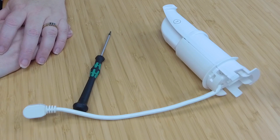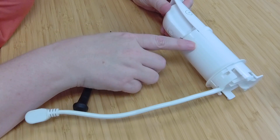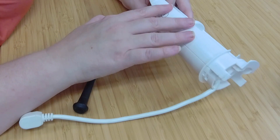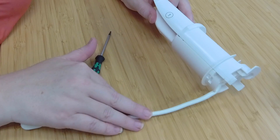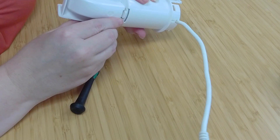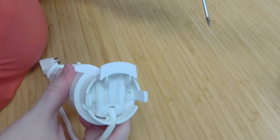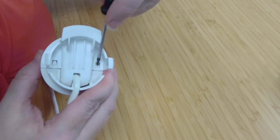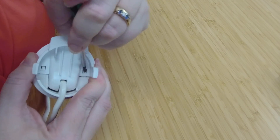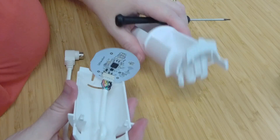You're going to need your two millimeter hex head screwdriver or another small screwdriver. We've got the rail holder here. The rail holder is comprised of four parts: a small plastic part on the lower side, the larger plastic part on the upper, the cable, and the antenna board — you can just barely see the antenna board right there. To get that antenna board out so we can reseat the cable, we're going to press down on the tab here.